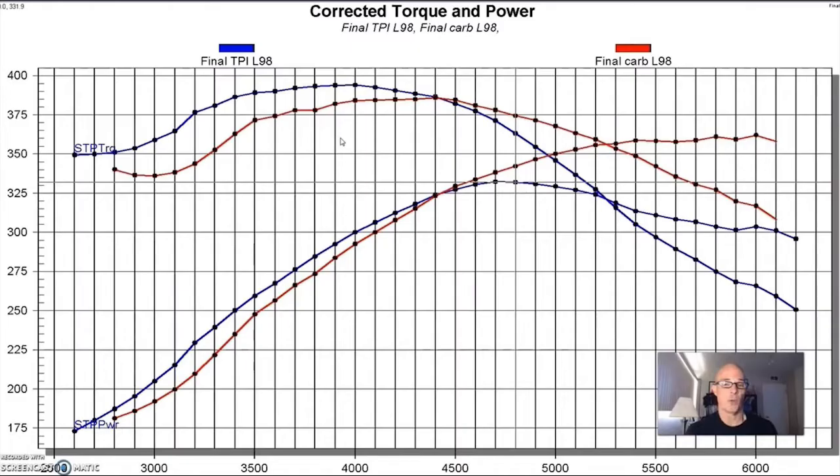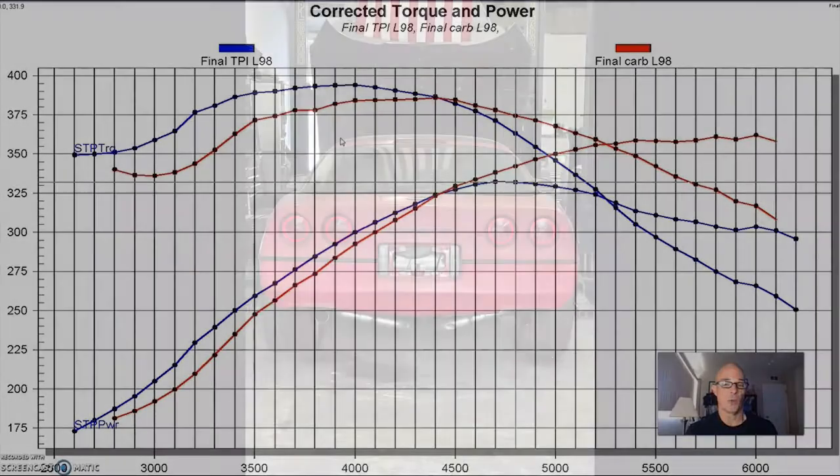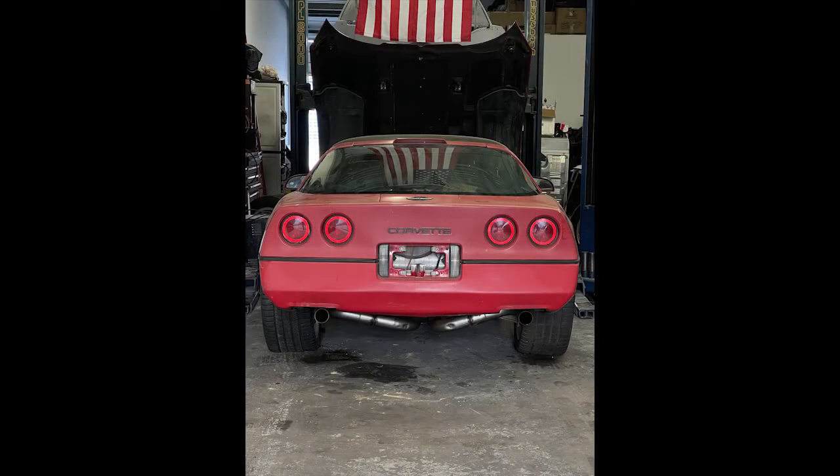Now I'm going to address the power and torque of a carb versus the TPI. Neither one is better than the other, because at the end of the day everyone has their set of goals and what they want to do with the car. For some people, they might like the low RPM torque of the TPI. For others, they might want a different intake manifold — single plane or dual plane — to make power at a different part of the RPM range. It's all on you to figure out what makes you happiest, because this vehicle is an amazing vehicle to work on with a small block Chevy, and considering we have an L98, we have a good engine to work on. Subscribe if you want to see C4 content on my channel — I got a lot of content planned, a bunch of shorts of exhaust clips, and I'll happily answer any questions you guys have.